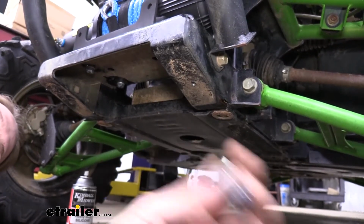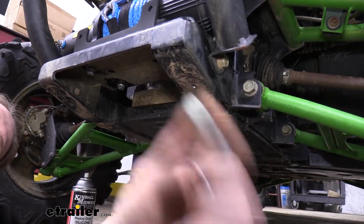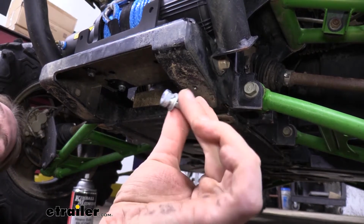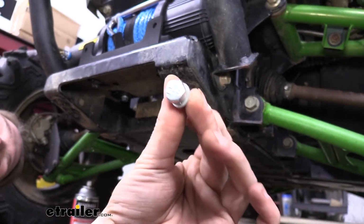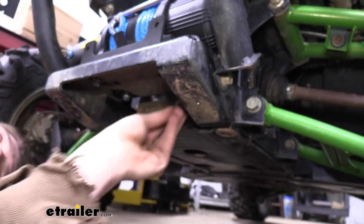You can check the bolt using the nut that comes included with the kit to see if it threads on your new bolt to make sure you got the right thread pitch. And then make sure that it's a quality 8.8 as well, so it's got the same grade. We can use the washers and lock washers that come with the kit.